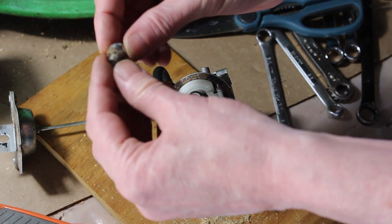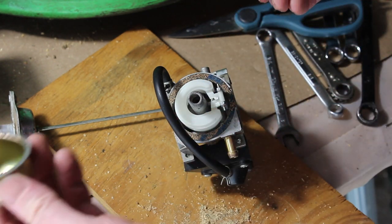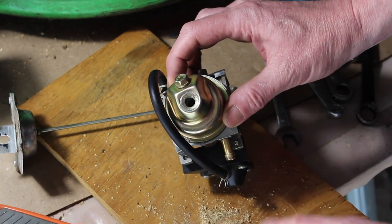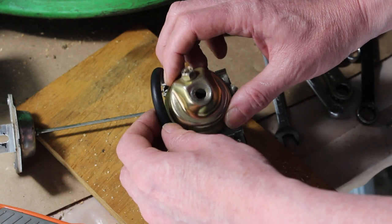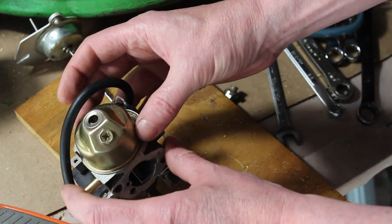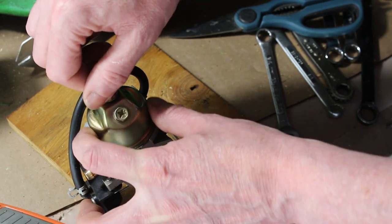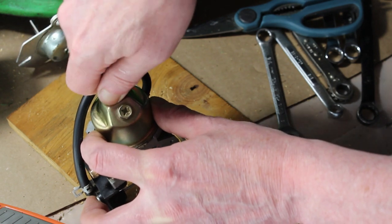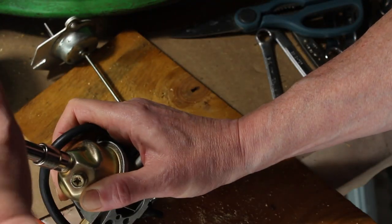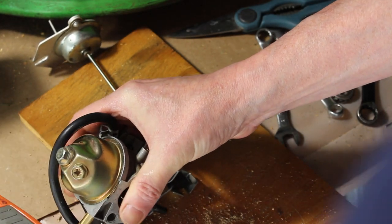I did put a little piece of cork around this bolt that goes on the bottom of the bowl. I just want to position and get this bowl fitted in there — yeah, that's an excellent fit. I want to make sure I have this bolt here facing outward. I'll go ahead and put my float bowl bolt in there — it's a 10mm, so we're going to tighten that up. I don't want to go too tight on it, just want it to be snug. So that's that.